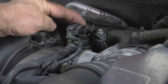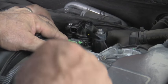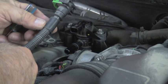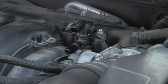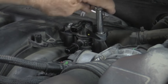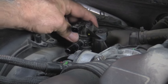The vacuum that's in this intake needs to get through this valve so it can travel back to the canister. It's got a simple little electrical connector. There's a little green clip that locks it in place — once you get the green clip out, the hard plastic molded line can come off. Let's take this valve off and see what we can find. There are just two little number eight bolts on it, and now the valve will simply lift off.